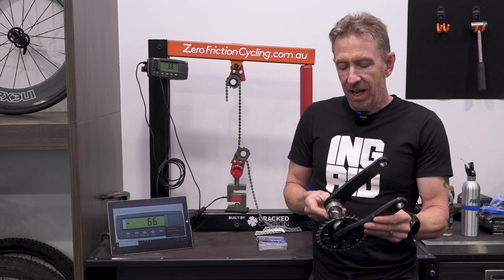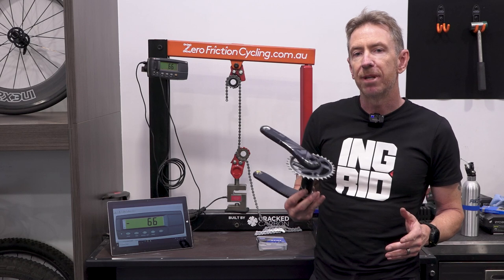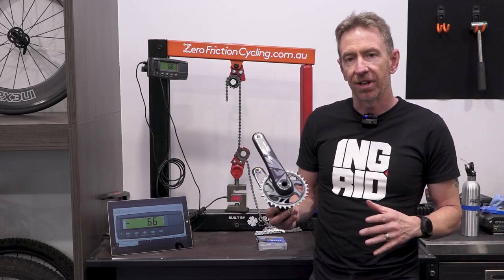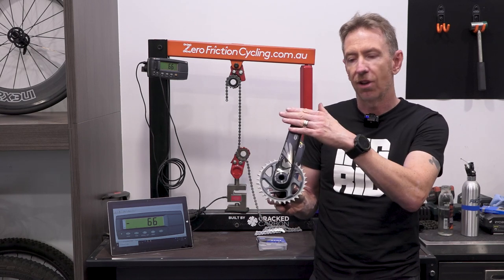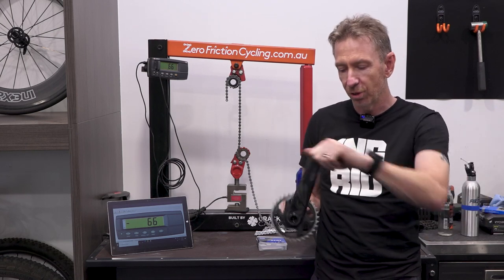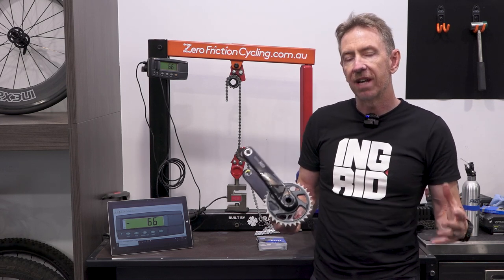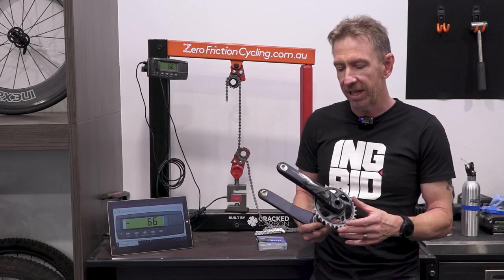Now, how strong are bicycle chains? There is an international standard that bicycle chains need to be over 8,000 newtons in tensile strength. So there's a pretty big safety factor for that particular scenario. However, there can be scenarios such as mountain biking, longer cranks, smaller chainrings, extreme chain lines, really putting out a huge amount of torque, where those tensions might get up to maybe double that, 800 newtons. Still a long, long way from the international standard of 8,000 newtons.